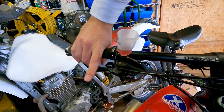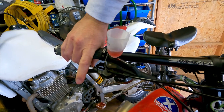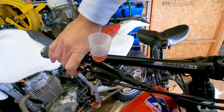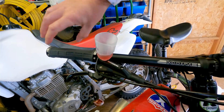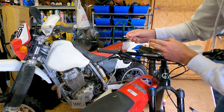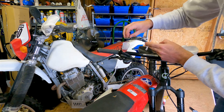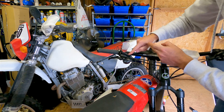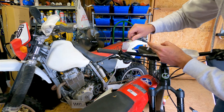Now let's pump the lever a bit. The lever isn't moving at all because the brake pistons in the caliper are locked against the brake block — so no sponginess. Insert the plunger into the funnel to seal it off so you can remove it without spilling fluid. Then add a couple of drops into the master cylinder to make sure it's completely full, and recap it.